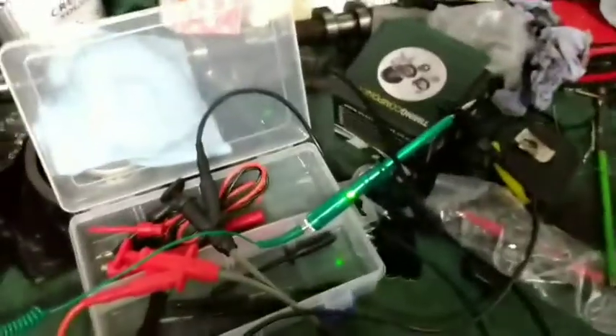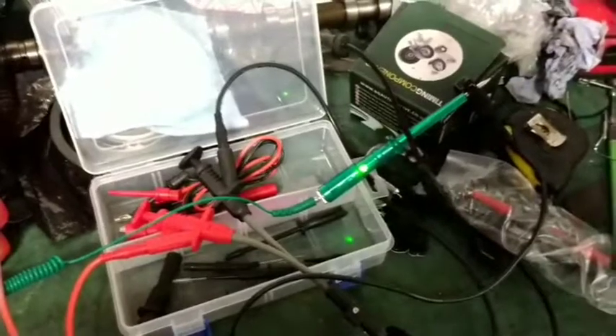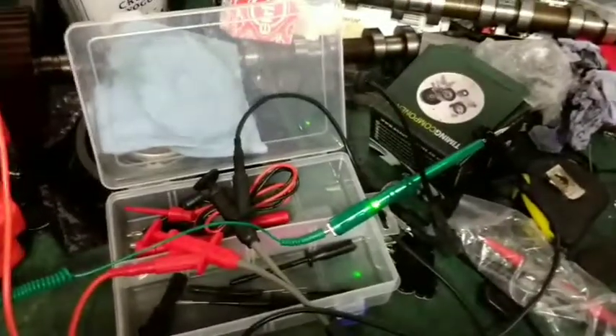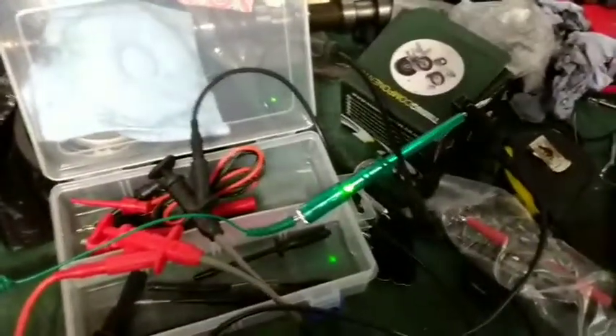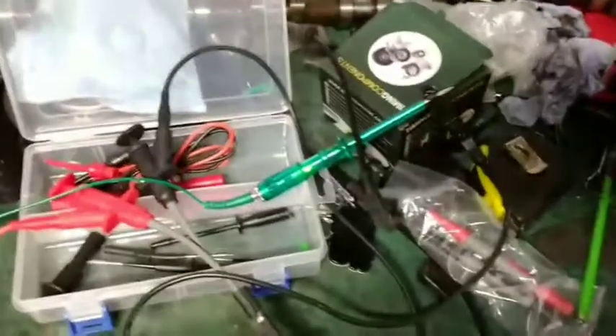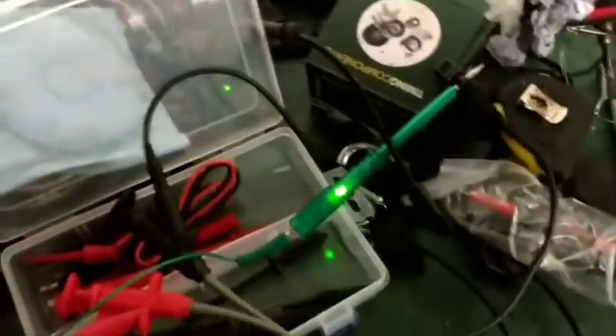I think this sensor, although it's doing this, it doesn't even work on the car. That's a problem I've seen with aftermarket ABS sensors. They work - you can sometimes reset the fault code, sometimes you can't. If you put it on, reset the fault code, and drive it, it doesn't think you're going anywhere - zero miles an hour shows up. I found these aftermarket sensors that are cheap - sometimes they just don't work. You buy a genuine one and it works fine. I've got two cheap ones here and neither of them work. They'll let you erase the fault code but they don't work when you drive the car.